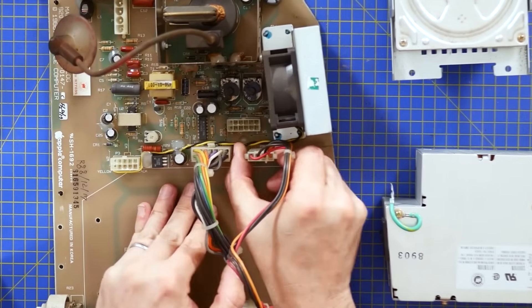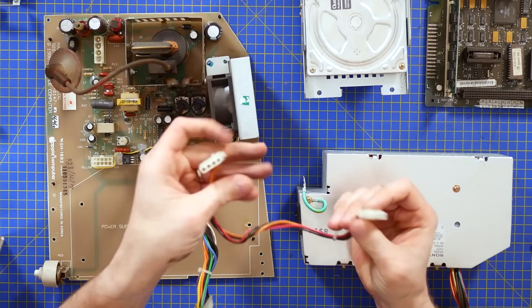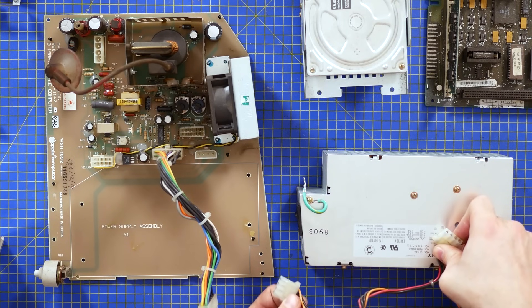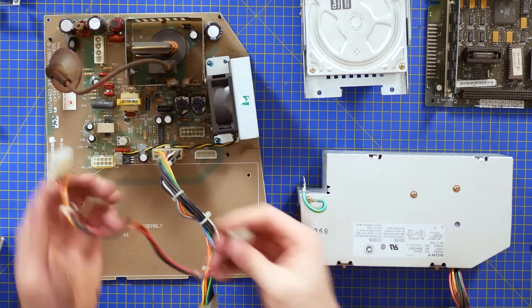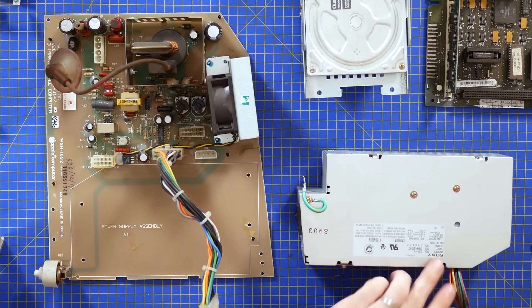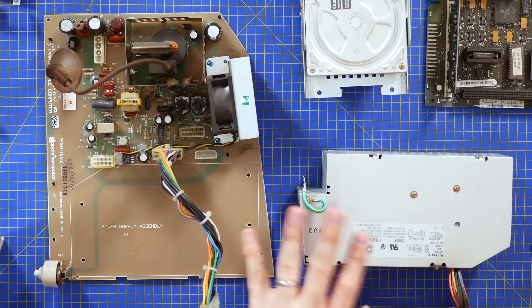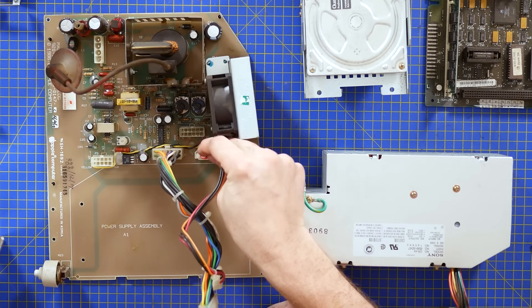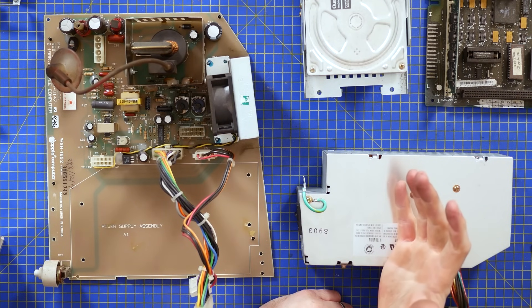It's such an interesting way of handling things — it's still not how my mind would instantly jump to engineering a PC. I'm so used to the ATX standard where everything is an IBM clone. What throws me is this connector here, which is actually the hard drive power — it's a Molex to Molex lead, and I don't think I've ever seen that in my life. They're clearly buying what appears to be a Sony off-the-shelf part and doing the engineering themselves. For something filled with dust, it still looks amazing.